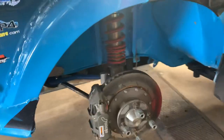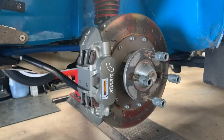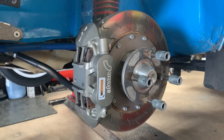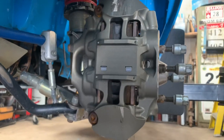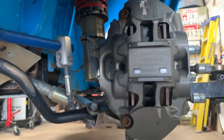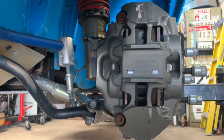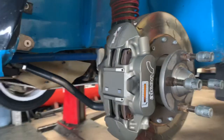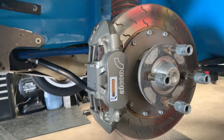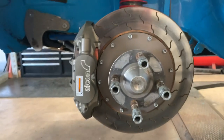The front is where it gets a bit more high-tech. We run the new Alcon R5 style caliper, which works really well. They're like a skeleton affair — fairly open, but really rigid and structurally strong. The openness of them is probably why they stay so cool; they're really good at dispersing heat. We've only had them on this season, but so far we're really happy with them.